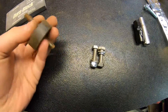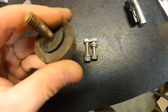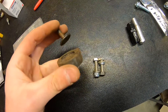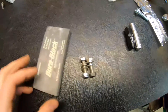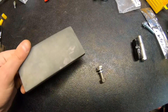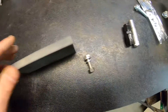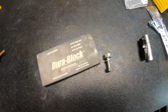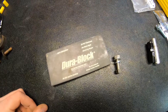Here's the problem: these were full isolation mounts where the threaded rod doesn't go all the way through. They used to be one piece but they're just worn out and came apart. The rear ones aren't in great shape either. What I'm going to do is use some stainless hardware and an old sanding block — a Dura block — which is the exact same thickness as the old mount. We're going to make some new mounts and send stainless bolts through them. They won't be full isolation anymore but for what this thing's doing, I don't think it'll matter.